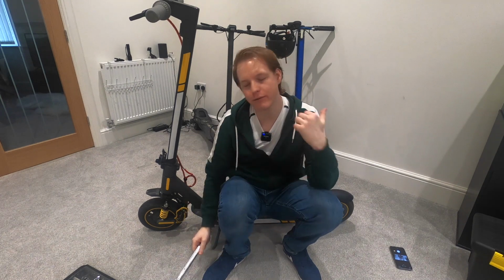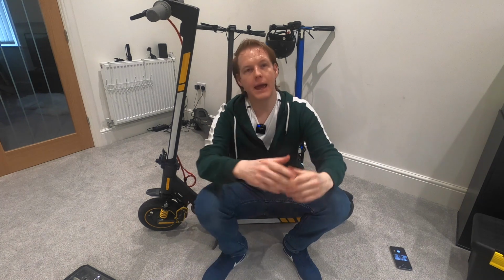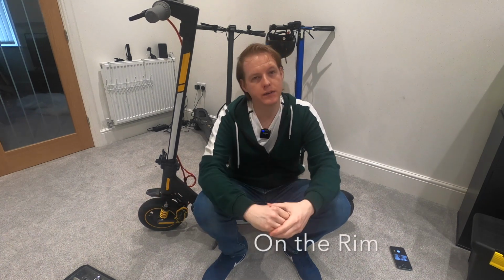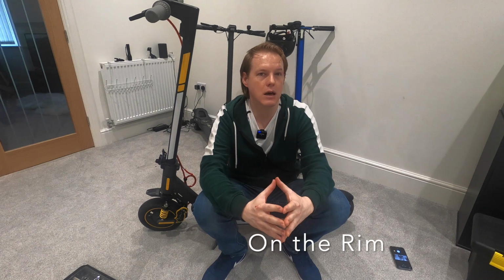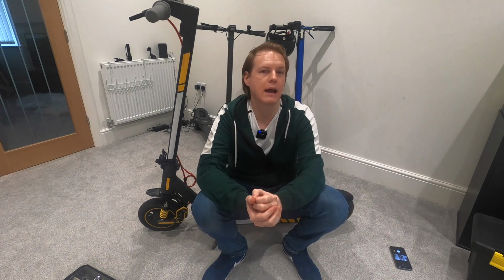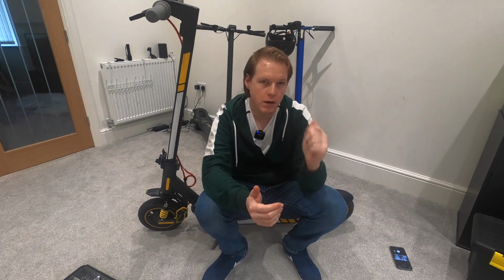And as you can see from the video, I will leave a link up here on how to change your tyre. It took me around an hour to do, and the hardest part of it was actually seating the bead on the tyre. So if you've got a car outside, the compressor for the car works, or you can take it down to the garage where they generally have air pressure machines where you can pump some air into it quickly to seat that bead.